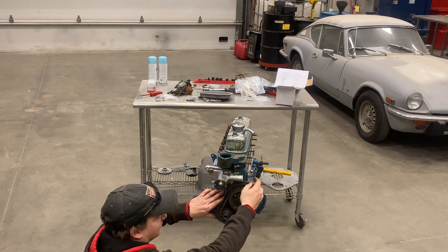I've glued the gasket for the oil filter as well — I definitely don't want that to leak. There is a crush washer that goes on each side of this oil line. The front cover should be ready to install now. I'm just going to put a bead of sealant along this edge. Now there are two different sized bolts — the bigger bolts go here, and there are smaller bolts along here, and there are also two different lengths of the smaller bolts. I put some grease on the crank pulley where the seal is going to hit — I don't want the seal to tear up when it's still dry, and that will also keep the oil from coming out of the seal.